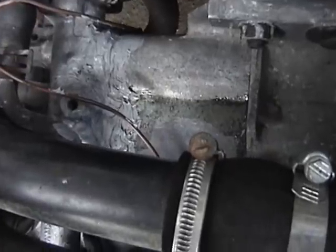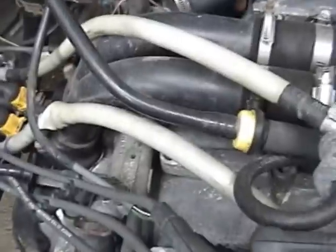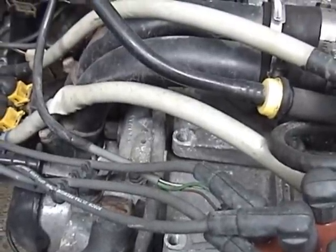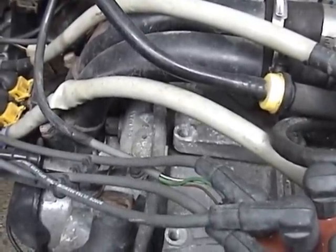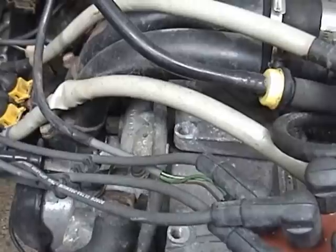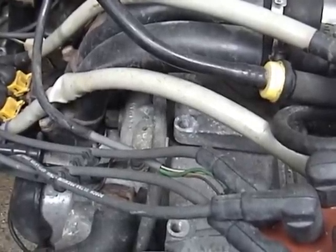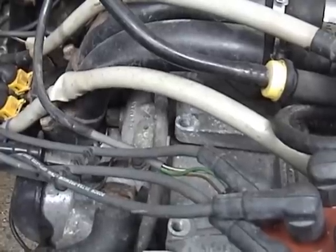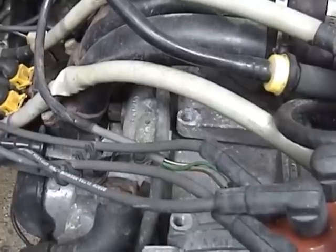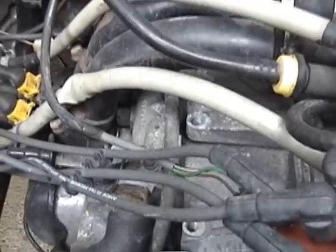You can see that bit of coolant — the driver's side head gasket is leaking. For those of you familiar with Vanagons, you know that 'head gasket' is a little bit of a misnomer. These engines don't have a proper head gasket in the traditional sense, and once I have this all apart I'm going to show you that. The engine is running pretty well and I'm not getting mixing of coolant and oil, which is good.